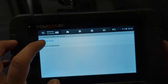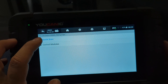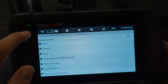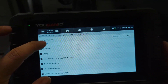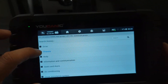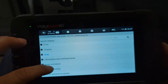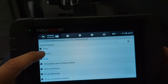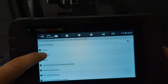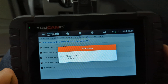You can do a quick scan, but quick scan is going to go through all the control modules on this vehicle. This car has over 40 different control units. We can select the control units on their own — these are actually sub-folders, and they have the control units inside them, grouped in different categories. In order to troubleshoot the electronic parking brake issue, you go to Chassis, then to Electronic Parking Brake, and press OK.